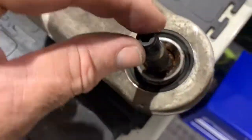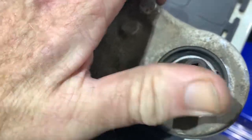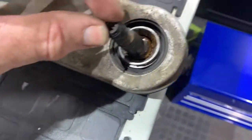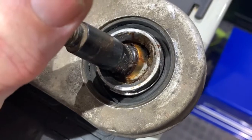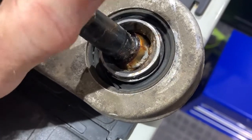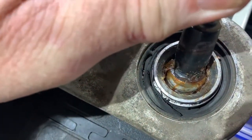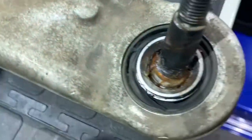The question is why and where does this movement come from? I've stripped the rubber boots off - the ball joint itself is actually quite good still, quite tight, no noticeable wear or slop in it, but it is certainly rubber-mounted. There is huge movement in this rubber mounting. I'm not sure what it's supposed to be like when new, but this is just finger pressure and it really does look like there's a rupture of sorts on that rubber. I think it's safe to assume that this rubber mount has actually failed and is causing our problem.